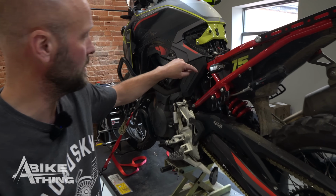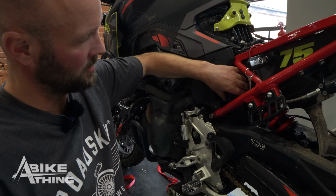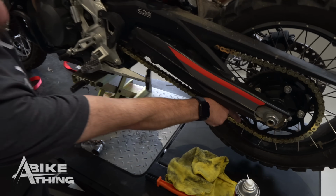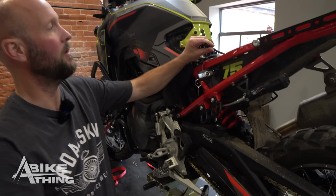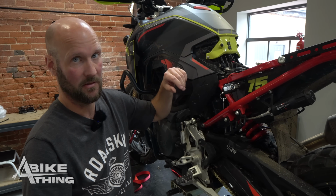I'm going to mount it to the charcoal canister on the side of the bike here. So it seems like a good position. It will hold it upright according to the instructions. I can then route the cabling down for the pipe with the oil on it, and it will just drip into there. It'll just drop onto the chain once every however many seconds I set it to via the ezCAN. Got a free circuit on the ezCAN here, all ready to go. Just got to plug my computer in, program it up. Shouldn't take long to fit, to be fair.